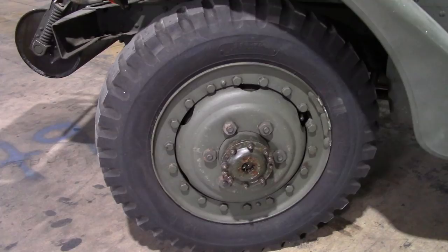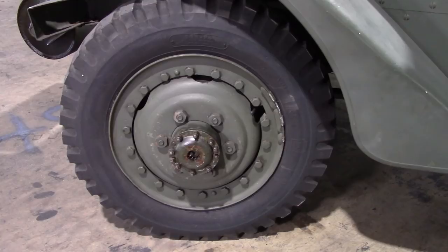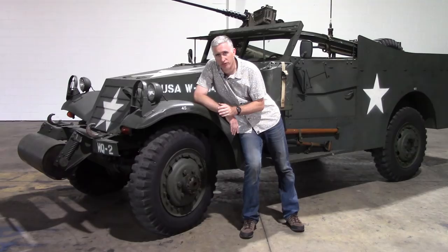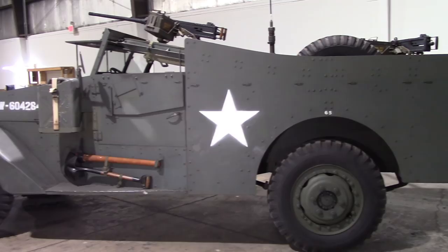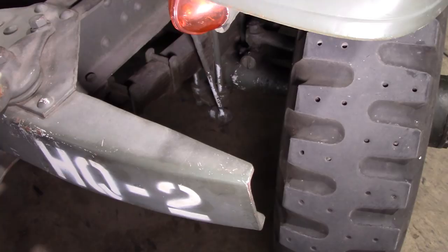The wheels are not exactly lightweight. The tires alone, with the heavy-duty tube, flap, and bead lock, that's 145 pounds. You then mount them onto 20-inch split rims. These rims — split rims, if you're not familiar with them — treat them with utmost respect if you have to work on the things. They can literally be lethal. Standard tire pressure is 45 at the front for the combat tire, 60 at the back. The earliest vehicles came with a standard-use tire, and it was only 40 psi.